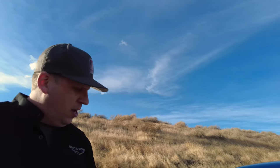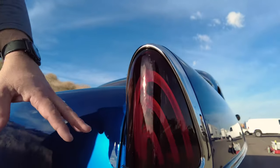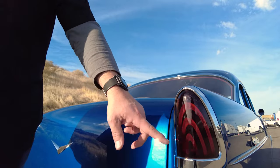Coming around the back of the car, the tail lamps are quite a unique feature. There are three arches machined out of acrylic, and at the bottom of each leg is an LED, so they light up and create a pretty dramatic effect. The rest of the inside of that assembly is all 3D printed parts.